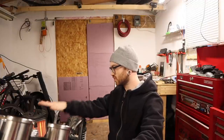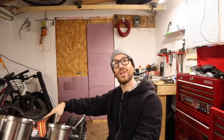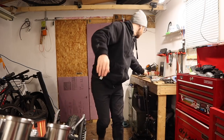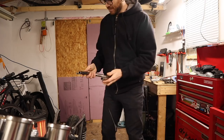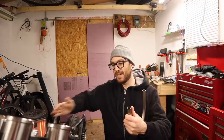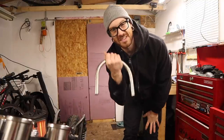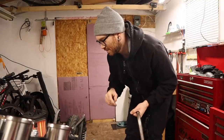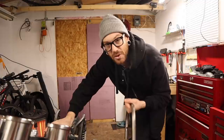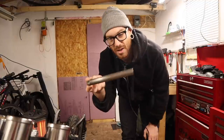So, pretty good progress for a couple hours of sticking a grinder into all of the spots where there's a lot of grossness left over from previous work. But I found myself trying to fit this on to get it on there straight. And then I started to drive myself a little bit crazy wondering if I really am off by anything, so I started measuring it. The measurements of the frame say that this should go on straight, at least from the reference points that I'm measuring from, but old bikes, I don't know that they're necessarily straight from factory anyway.